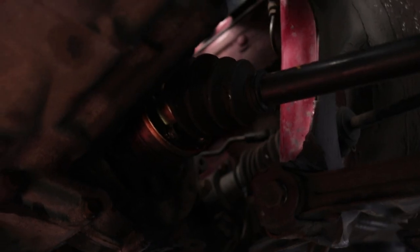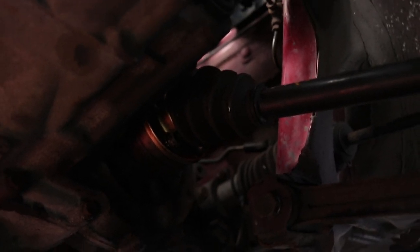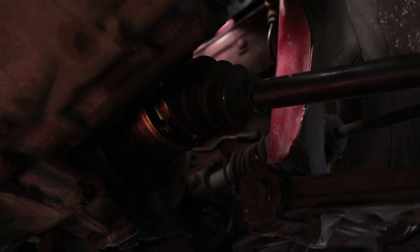I'm going to loosen this now, and the CVs as well, and that should let us take the drive shaft out. Once that's removed, we can take the gearbox loose, shoot it loose and drop the gearbox — it'll be a bit easier to work with. At the end of the day the gearbox has to be removed anyway because I'm going to be reusing it with the new motor. I'm sending it away for some modifications to make the 2-litre clutch work, so the gearbox has to come out now.